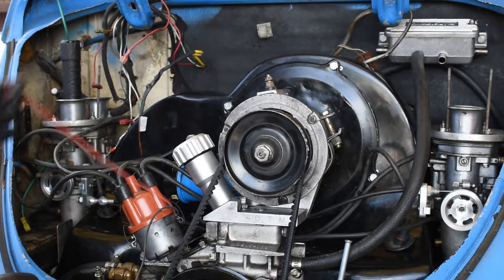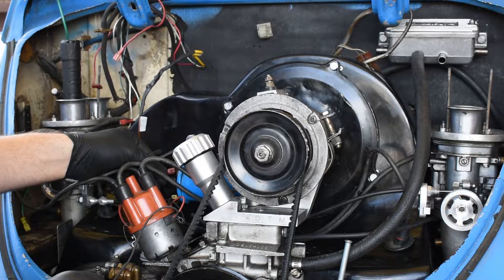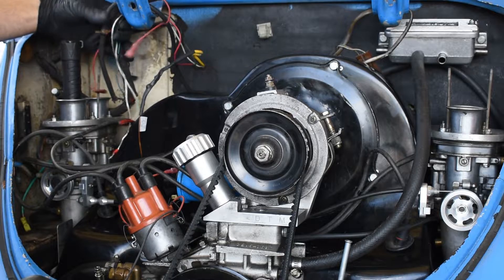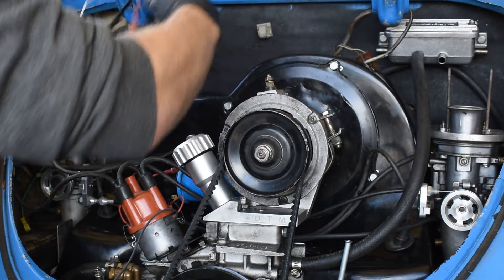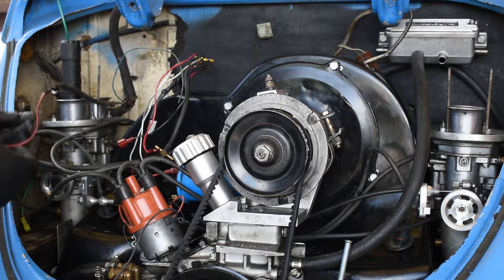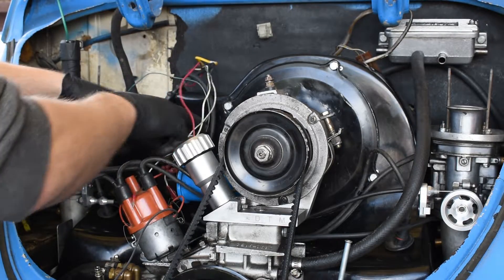We are back at the wiring adventure. The 15 side is the hot side of the coil. More red wire from my distributor — the black wire goes to... okay, let's start. This monkey's nest is the wiring. Going to the alternator with those last. This ghetto-rigged red one is power, so it goes to the hot side — kind of tuck it down under there, out of the way.